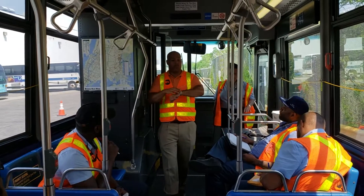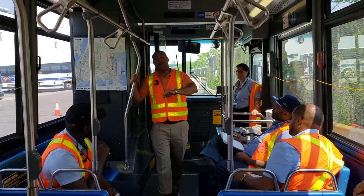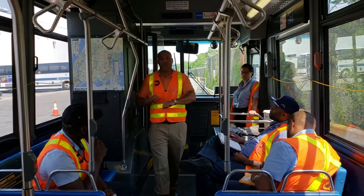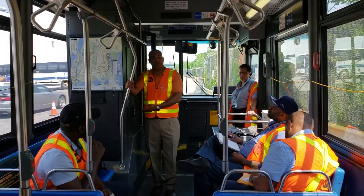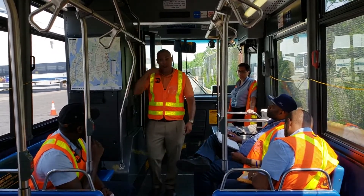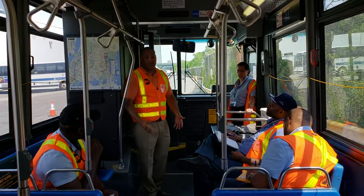You're here, you're watching the gauge, and you're looking for 60 seconds to pass. When 60 seconds pass, let it go, and it should not drop more than 2 PSIs. My air leakage brake check — I have no leaks.